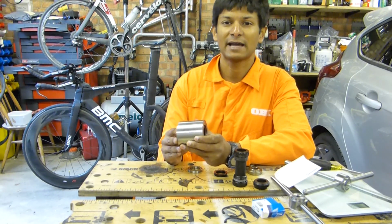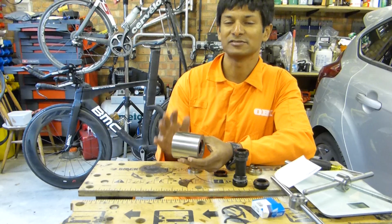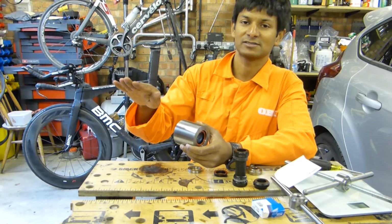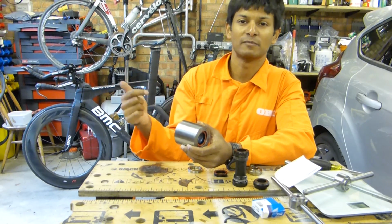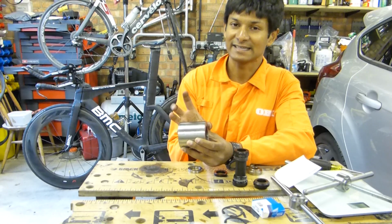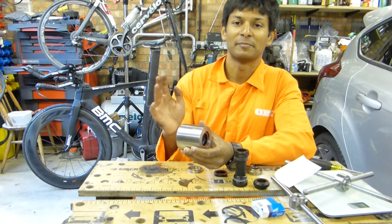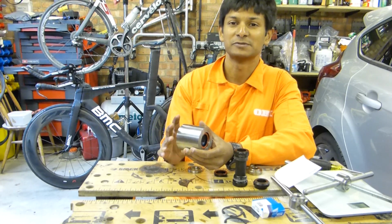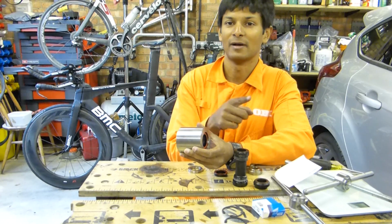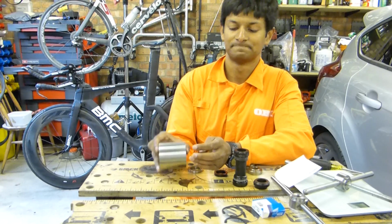The other aspect is a biomechanical aspect, which is to do with something called ankle clearance. Now, ankle clearance does not affect everybody, and it's to do with their feet positioning on the pedals. So if your feet toe outwards quite considerably, that moves your ankle towards the centre line of the crank. By having a very narrow bottom bracket, which this is, then you can increase that clearance. The problem is only Cannondale and a few other manufacturers use that, and the vast majority actually use the Shimano standard, which is basically 90mm across the drive side to non-drive side, whereas this one is 68.